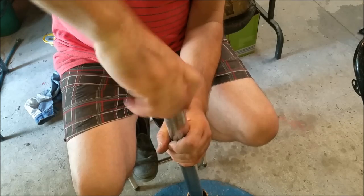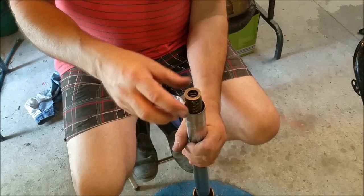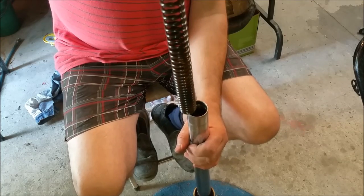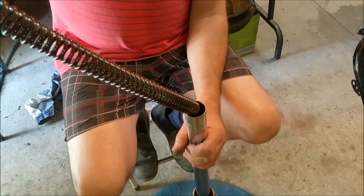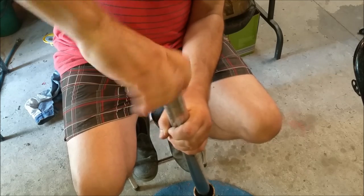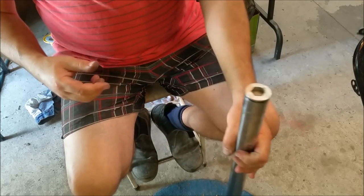There's a little bit of spring tension at the cap but not much at all. Inside is an aluminium cap and an O-ring — and because it's an aluminium cap against a steel spring, there's a shim there to protect the aluminium. It's a variable rate spring with the tighter coils at the bottom. But I'm going to leave it in for now and undo it a different way. At the base of the fork there is an Allen head bolt — or hex head bolt — and it's got a copper washer on it.